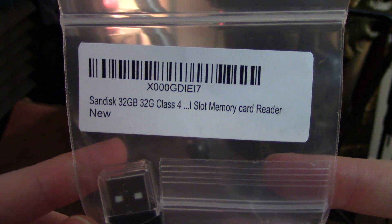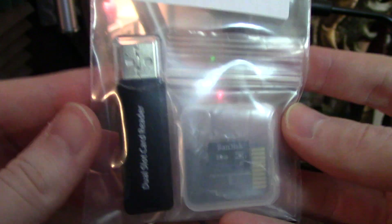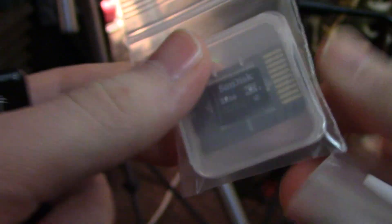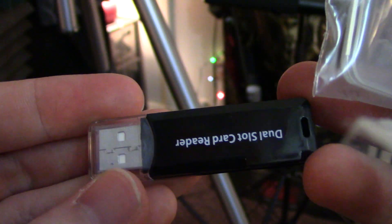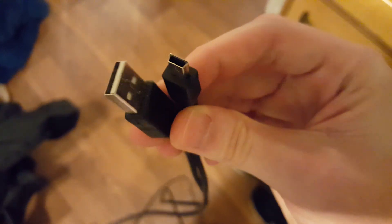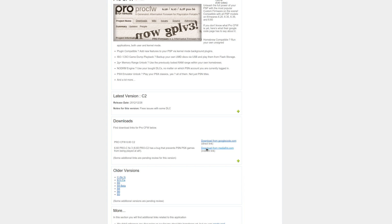You'll need a memory card — the PSP takes a Memory Stick Duo card. I actually found a nice set of a 32GB microSD card, a microSD to Memory Stick Duo adapter, and a USB card reader for about 12 bucks, and it works great in the PSP. This is a much better option than trying to buy a real Memory Stick Duo of any big size, so I'll post a link to that in the description below. If you don't have a card reader, you'll need a mini USB cable to connect your PSP to your computer. Lastly, you'll need the PRO-B custom firmware files — links will be in the description below.